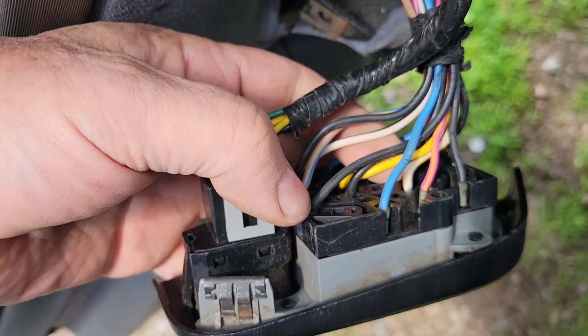I've already put in a known good motor and plugged it into that side. The only constant I have on this side is that blue with black. So I'm going to guess: blue/black to the white with yellow, or the red with yellow to the brown with blue.